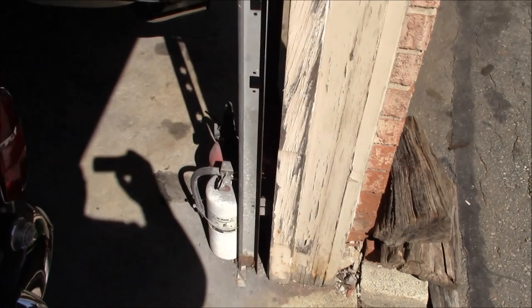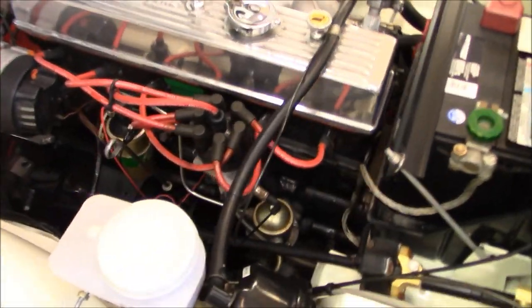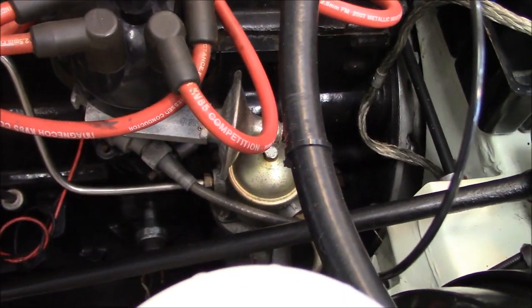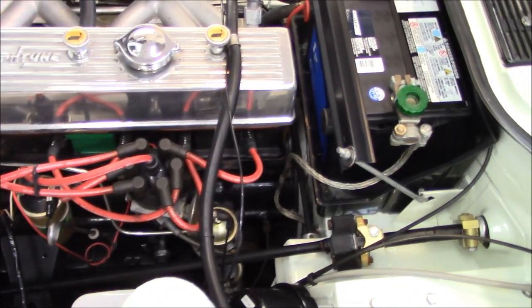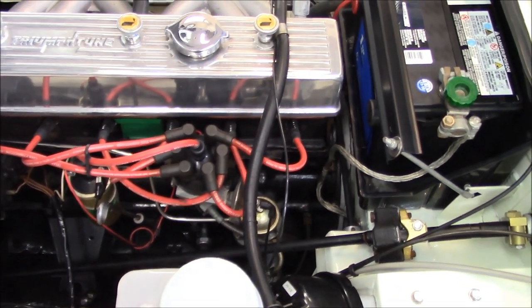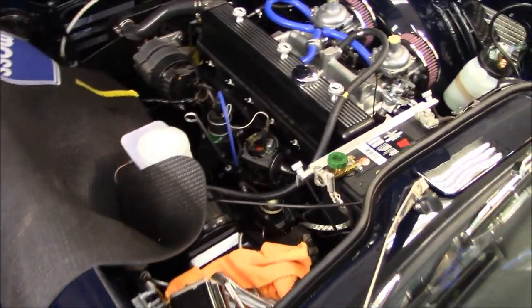I can show you what it's supposed to look like on my TR6 for reference. You can see the position of the distributor in the TR6 and how the cable routes away from over the top of the fuel pump - that's ultimately what I'm trying to do with the TR250. That may also mean I need to rewire the distributor cap and move the plug wires around one location based on where the rotor ends up pointing when I get it to seven o'clock.